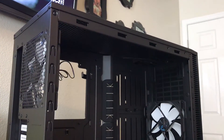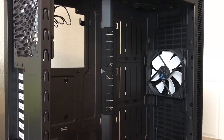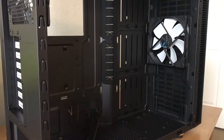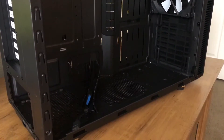As you can see, the open space in the case allows for extensive cooling options. Included are two Fractal Design GP14 140mm fans with one up front and one in the rear. There is also room for CPU coolers up to 185mm tall and plenty of space for larger graphics cards, allowing GPUs up to 430mm in length.